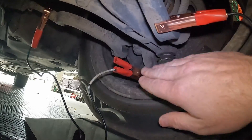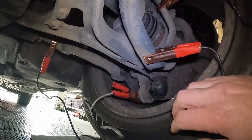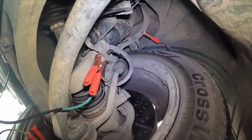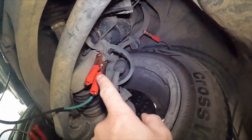So let me move these around. I'm going to leave that one there and move these other three to different locations and see if our lower ball joint is still the loudest or if there's something else. That far one is on our upper control arm — that'll let us know if the squeak is coming from our upper ball joint.